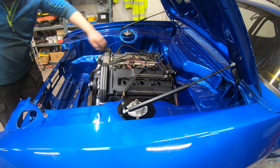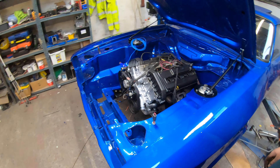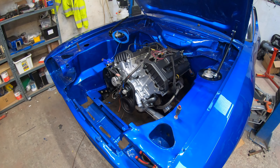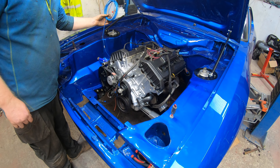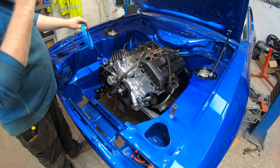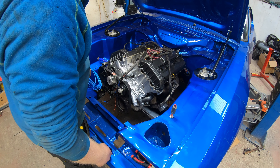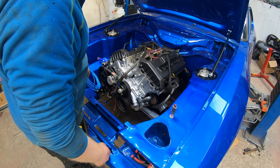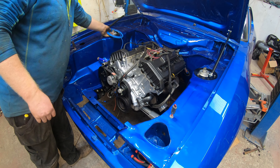That's the rough location of the wiring loom. I don't have to be too precise right now because I know it all fits on the engine side of things. I do have a few more bits and pieces I should add to the wiring loom. I might run the main charging wire along the same route as the main battery cable from the alternator, cable tied to it, and then join it into the loom on the multi-plug.